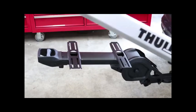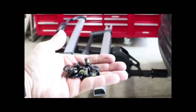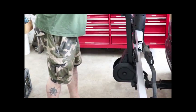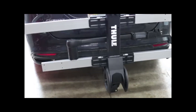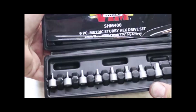So let's move on to the layout of the main beams. The one with the Thule logo goes on the rear side. I installed the four socket head machine screws that hold each of them on just finger tight, and we are going to squeeze the handle and pivot the rack upwards to make the tightening of these easier. Although Thule was nice enough to provide us with the required allen wrench, I am going to use a ratchet with my stubby hex drive sockets to tighten these.